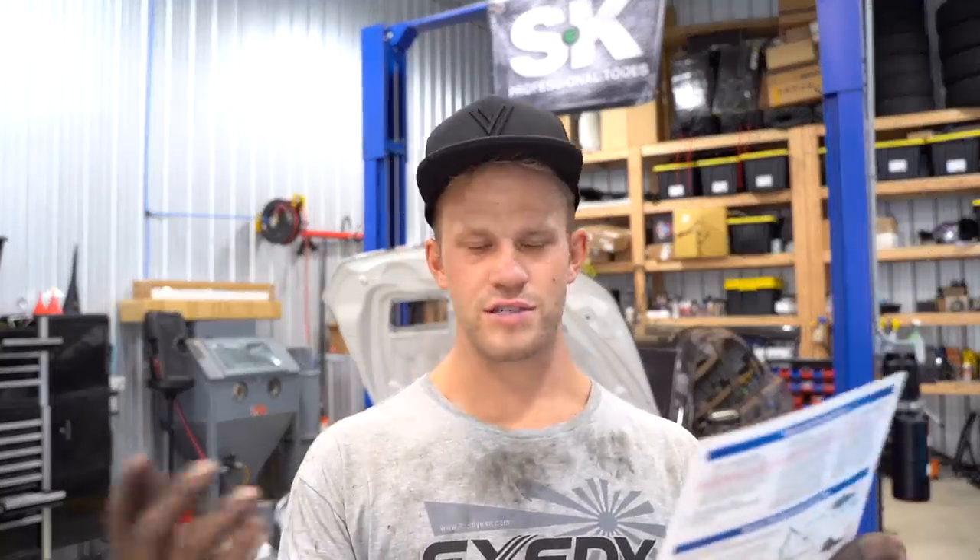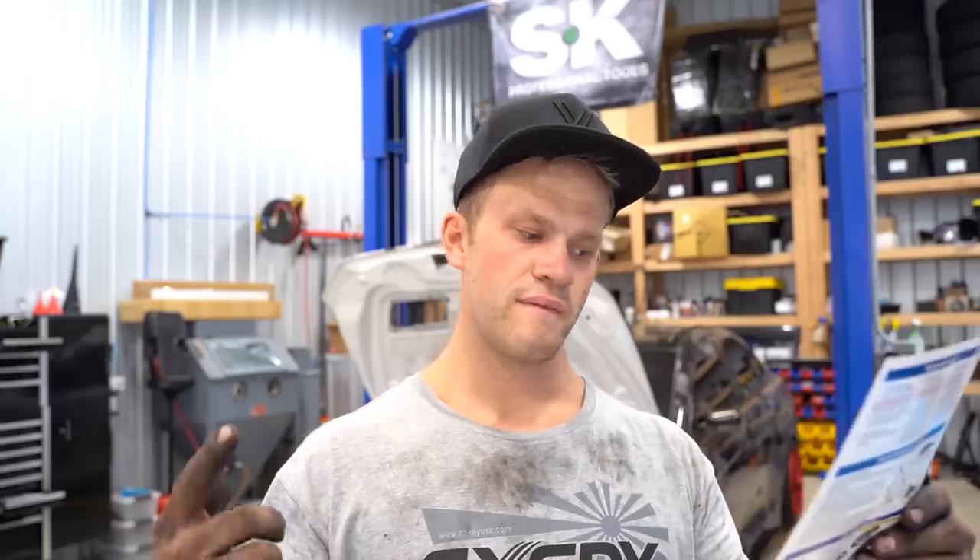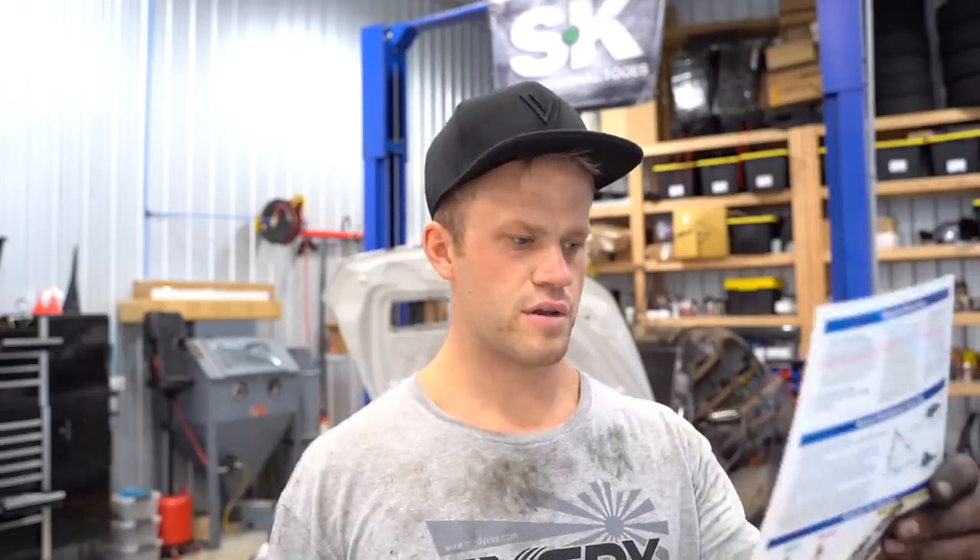The car is done and back together — well, not 100%, we still have the skid plate. I want to pull this car somewhere and fresh-wash the whole underside since some of that CV axle grease got everywhere. I'm going to get cleaned up and then we can go drive the car. We've got to break this thing in — the instructions say 500 miles road test, never abuse a newly fitted clutch, allow a 750-mile break-in, and adjust free travel at 750 miles, 1,500 miles, and then every 10,000 miles after that.